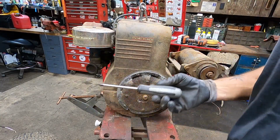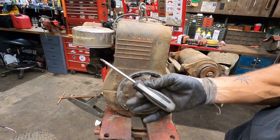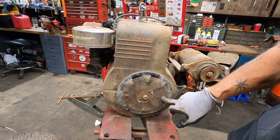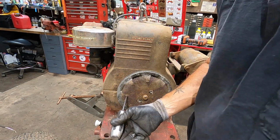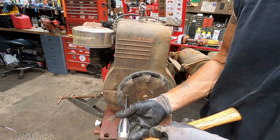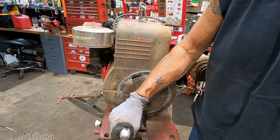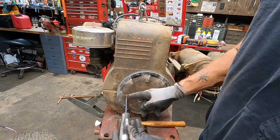to say I do not know how I went so long. Sometimes you just have those tools that you don't know how you did without for so long. Well, I didn't do without. I just simply broke the heads of the screws off into the aluminum flywheels. But now with this impact driver, and it's JIS, so it fits the Phillips screws actually better than a Phillips driver. Just give it a little whack as you're pushing in and turning, and it will slowly turn that screw.